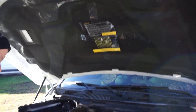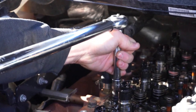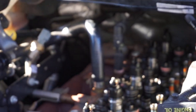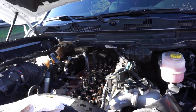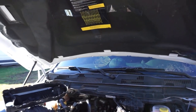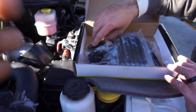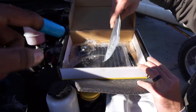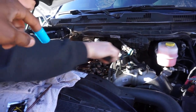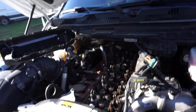We're about to torque the first one — it's already on there. You're going to torque it to 40 foot-pounds first, that's the first torque per Exotic's spec recommendation. Then bump it up to 80 foot-pounds. We taped the instructions to the hood which makes it really nice to just look up and read. Final torque is going to be 125 foot-pounds. The torque specs are actually identical to ARP's.